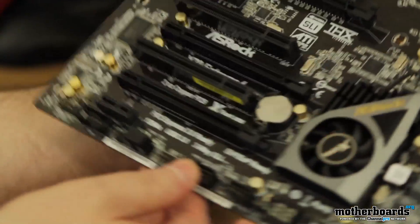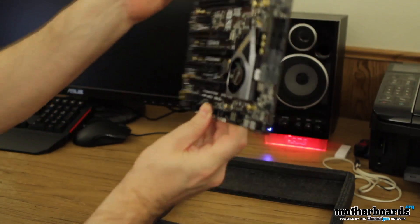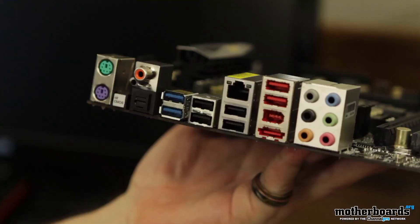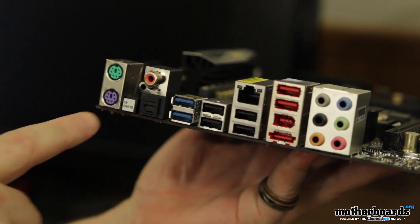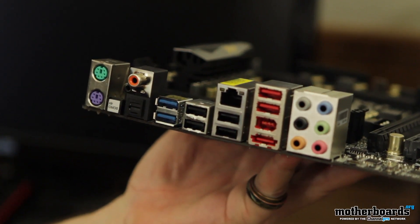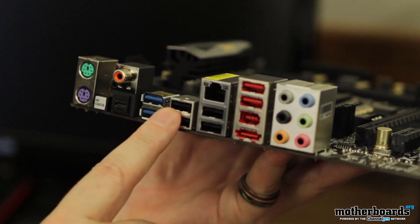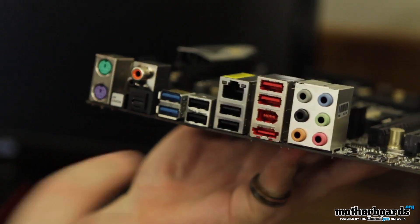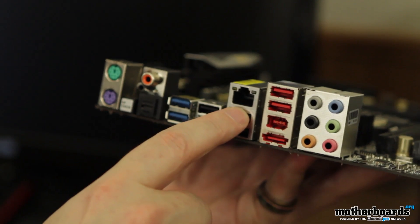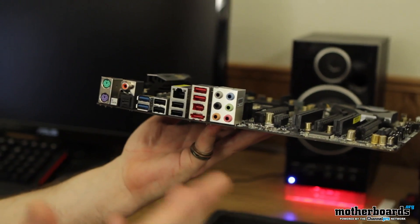Let's flip around and show you guys the rear I/O. Right off the bat we can see that we have your standard legacy keyboard and mouse port. We also have the clear CMOS button right here — this is pretty cool if you're doing overclocking and it's not starting; you just clear it up real quick. You have both S/PDIF and coaxial for your digital audio. You have two USB 3.0 ports, and two, four, six of your standard USB 2.0 ports. You also have a single FireWire port and a single eSATA port here as well. Last but not least you have your RJ45 for your LAN, and finally for your analog audio you have all the controllers here. Most motherboards these days are auto-detect — no matter which plug you plug in, you should be able to choose it and get your speakers up and going.